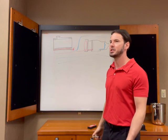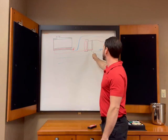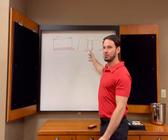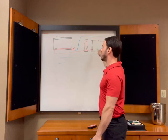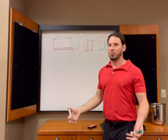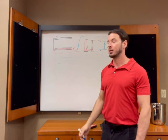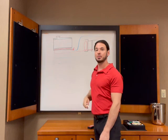It wasn't really the ones that I have seen that did this in its very, very early production. They changed it actually in 1992. It wasn't the heat. You could tell it might have gotten a little warm, but the thing is, his bearings were trash because they weren't lubricated. It didn't take very long to tear that up either. So what is the appropriate fix for that? Well, the torque converter should have been replaced. The radiator should have been replaced.